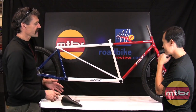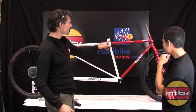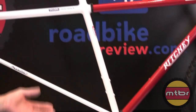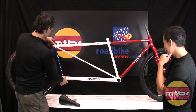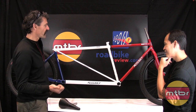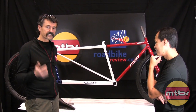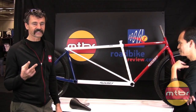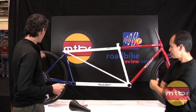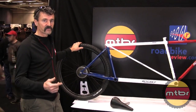This bike represents basically four years of testing the tandem concept in a breakaway. You have the couplings right here — the front end comes apart, you have the center section, and then the seat post which is removed at the coupling. The other interesting thing about this bike is that it's designed to use two different wheel sizes. It'll have disc brakes and you'll be able to put in a road wheel, because the diameter of 650 and the diameter of a road wheel are the same.